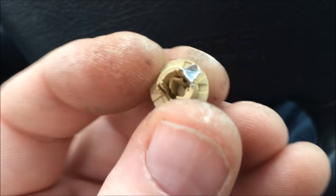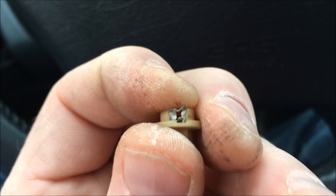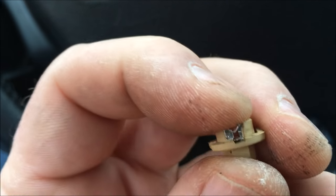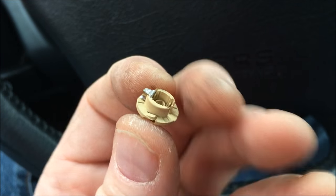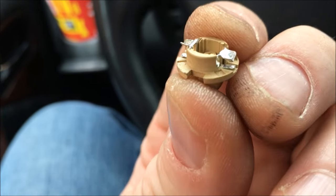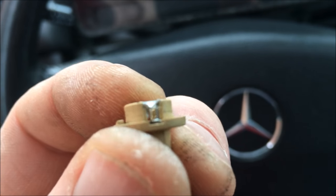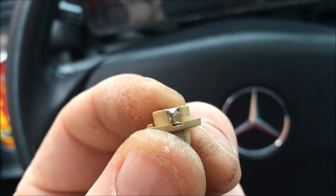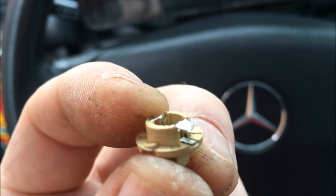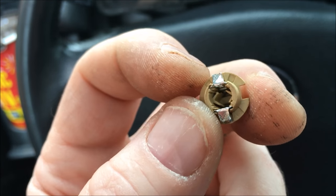I've broken this one pin off and slid it back into that little slot. You see at the bottom there's a slot, and at the top there's the same slot - it will simply push back down in and lock in place. The second one is pushed in now. On the bottom of the silver connector, that little piece has a gap between it and the plastic - you want to make sure that gap is there so it'll make good connection once it gets inside on the circuit board. Now we're going to take our T5 and stick it in there.